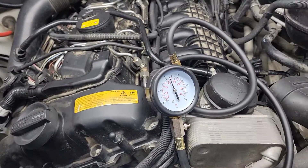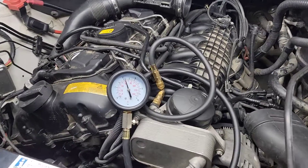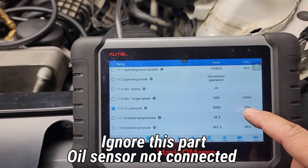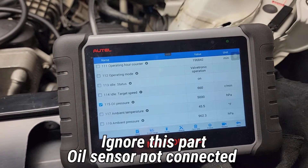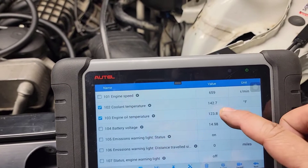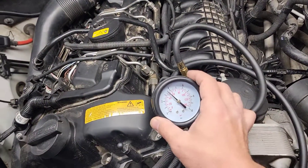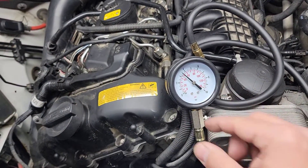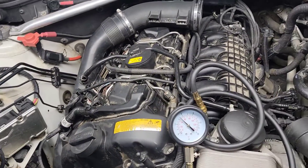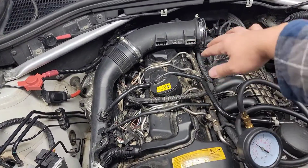This engine has been running for about 10 minutes and the temperature is normal. I hooked up my auto scan tool — it shows 5000 hPa, which converts to about 70-something PSI. You can see the coolant and engine oil temperature — we're on the right spec. At idle it's steady at 50 PSI, so this is a good healthy engine and the oil pump is good. We did replace the intake camshaft on this.